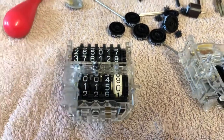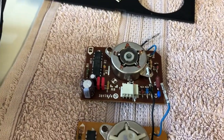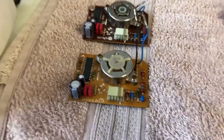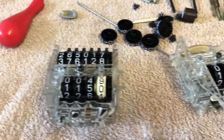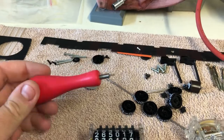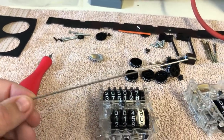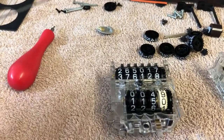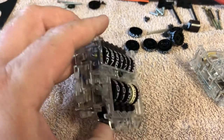The other problem I had when using the EA version of the odometer is that the cruise control stopped working in the EB. These do look identical but they have different board numbers, so there may be some minor changes. I've de-pinned these from the assembly using a pair of pointy nose pliers to gently remove those pins. I also have this tool that the guys at work use for wiring and cabling - it's absolutely perfect for punching the pins out - and a piece of welding rod which is almost the same diameter and works perfectly as well.